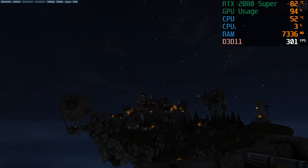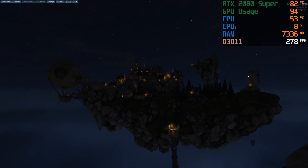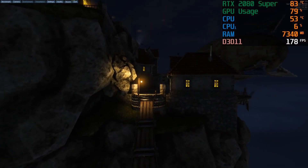We just finished running that benchmark for ten minutes, and the temperature never did peak over 83 degrees Celsius, which is pretty good — especially considering we've been using basically the full potential of the graphics card over that entire period. You shouldn't be expecting to use that much of your graphics card for a normal task or even normal gaming. I usually never get that much percentage of usage out of my card, and those temps never reach that point during normal gaming. This more represents how high temperatures can be at absolute maximum.